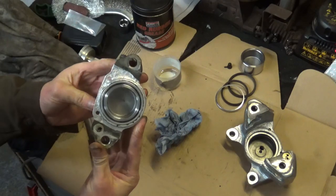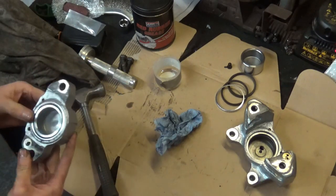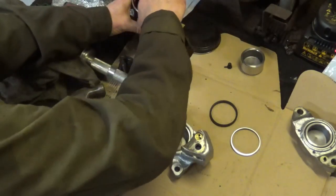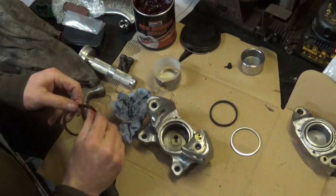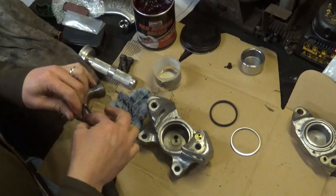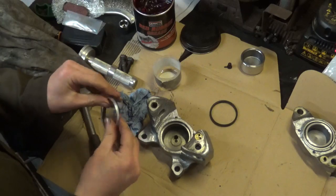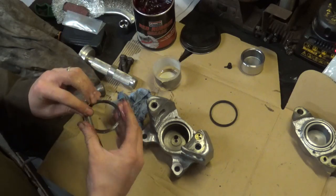Now that's one half of the caliper bolt, sorry. So I'll repeat the process for the other side. Again, I want the thicker seal. I daubed off red rubber grease. I've got links in the description where you can buy all this stuff, but if you're mechanically minded, you'll know where to get it anyway. And just stick that in there. Again, try not to twist it.